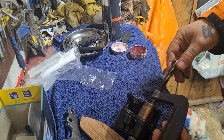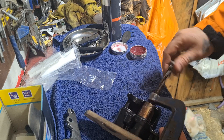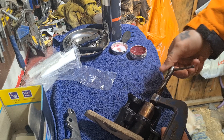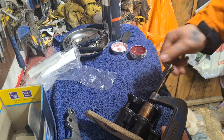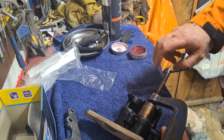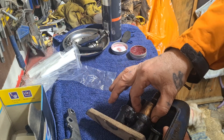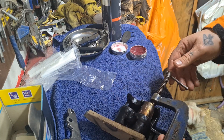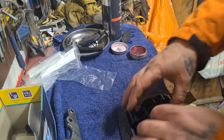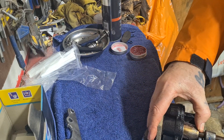I suppose there's a tool for this, but if you saw my last video, I did mention I'm a Yorkshire man. When we were getting the pistons out, there are tools to get the pistons out, but I found that if you put an allen key in — and I think it was a 10mm drill bit — it would sort of lock together as you turned it and help to get it out.